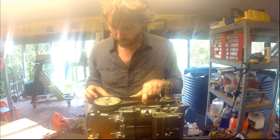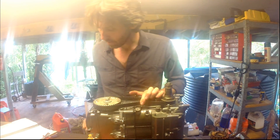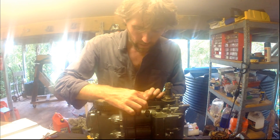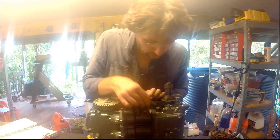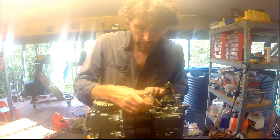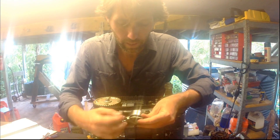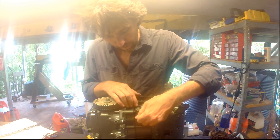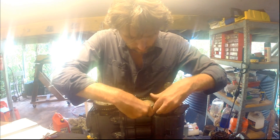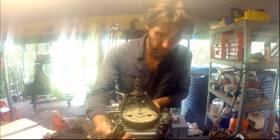The next thing we need to do is install the tensioner to take the slack out of it. I'll bring that slack round to the side of the belt where the tensioner goes. The tensioner has a few parts: first there's a spring which sits on this little protrusion here, and there's another one here with a groove where this long arm sits. Then we take the tensioner wheel that the belt runs along — there's a little hook here and we have to hook the spring, and that's what pulls the tensioner in towards the belt. I'm going to have to turn this around to install it.